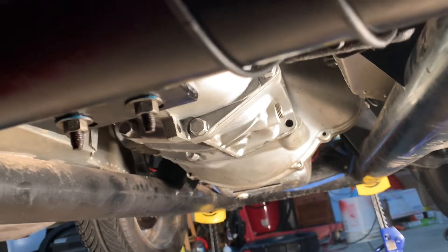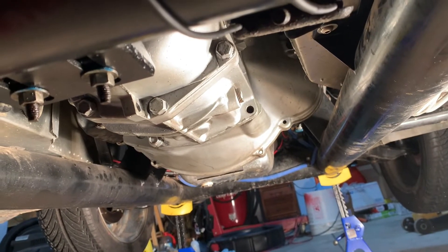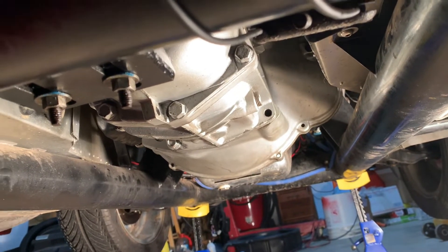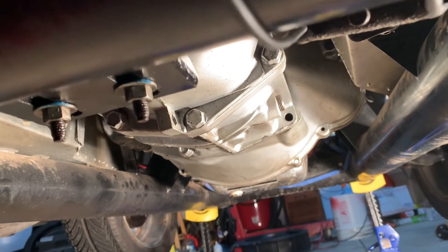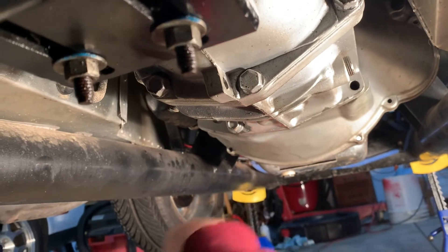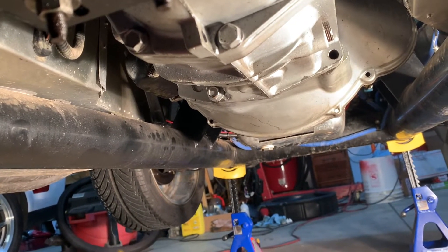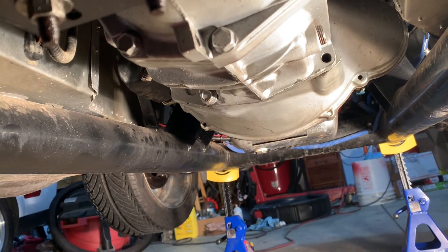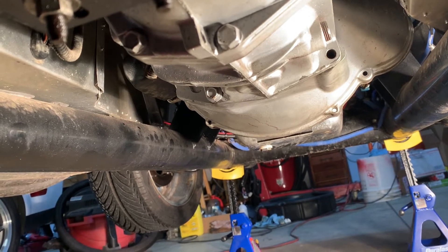I apologize — not the best video angles; I'm laying on the ground and this thing's only a couple feet off the ground, so doing the best I can. Looking at the transmission, it's pretty clean. There was a little bit of oil coming down from the bell housing — I think I mentioned that in the previous video. Pretty sure it's the intake manifold gasket leaking in the back and dripping down the side of the head on the driver's side, so I'll look into that down the road. It's on the to-do list.